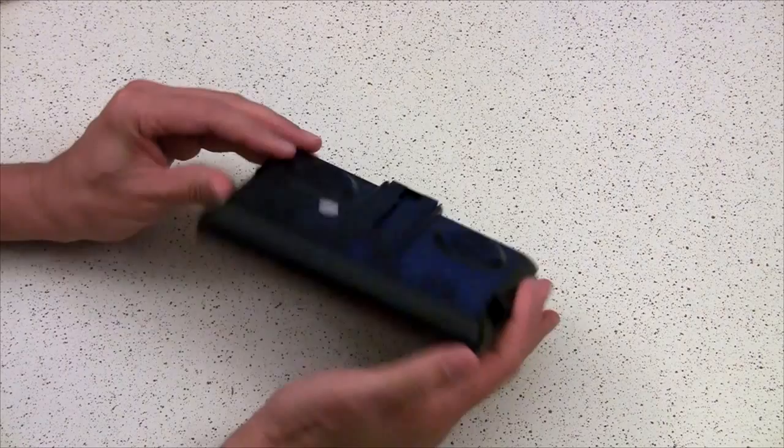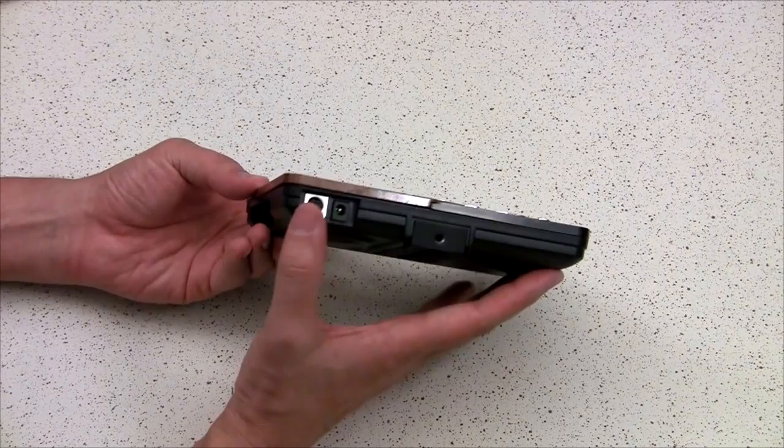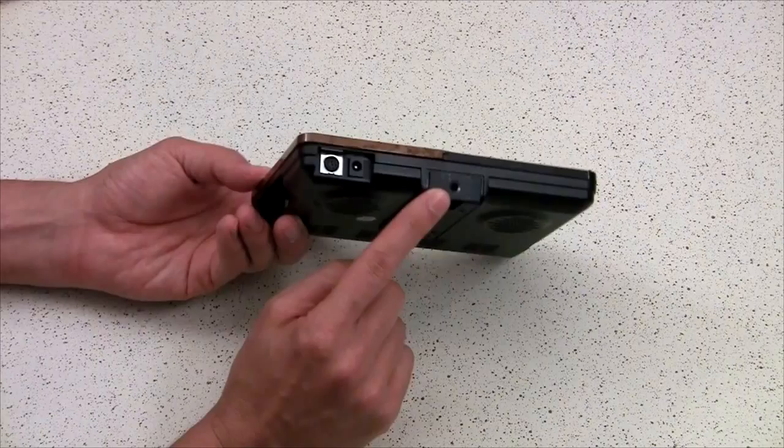and before we can even check it out or test it, we're going to have to examine the outside for a few different things, like power, since we kind of got rid of our power options right here. We need another way, which is fortunate because the monitor actually has its own power connector right here, separate from the breakout cable socket, so that we can power it that way. We've also got a threaded mount down here so we can mount it. Now this actually was not the standard quarter 20 thread, it was something smaller.